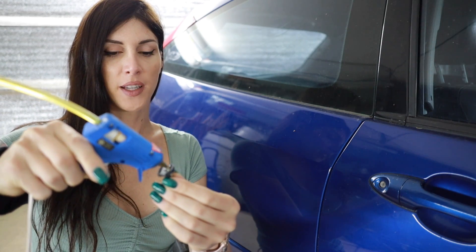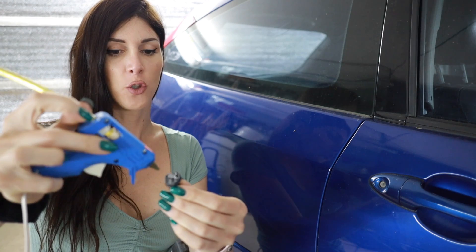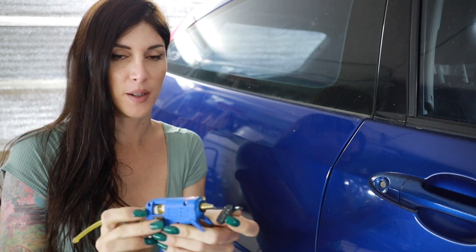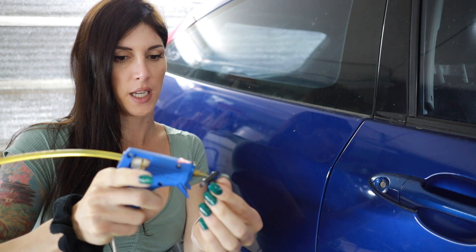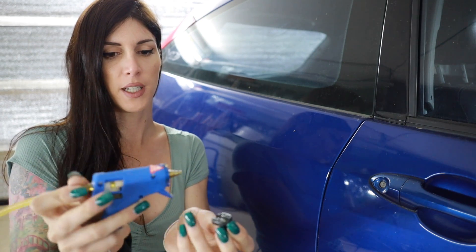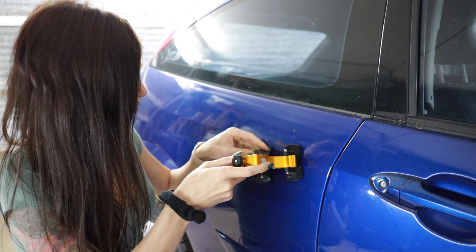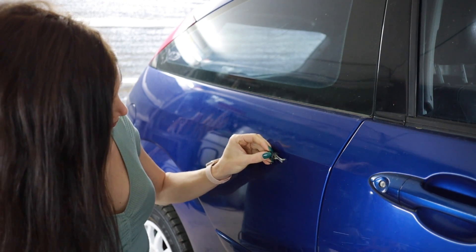Next one I want to try is right here — you can see it's kind of a long dent. It looks like a door edge that hit it. I think it's really important when doing something like this to manage your expectations, especially if you're paying a PDR technician. Understand it's not a miracle cure-all for dents — some dents are just not going to come out no matter what. And if you buy a cheap kit like this, manage your expectations even more because this glue that came with it absolutely sucks. Here it goes. Oh, that was a satisfying pull, and the glue came off with it too.